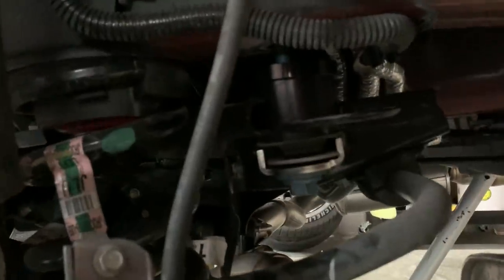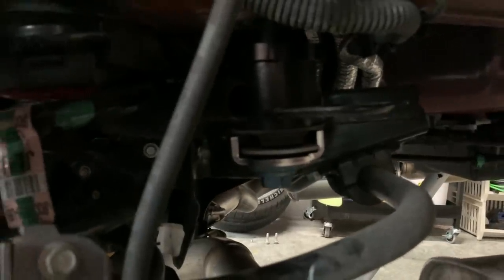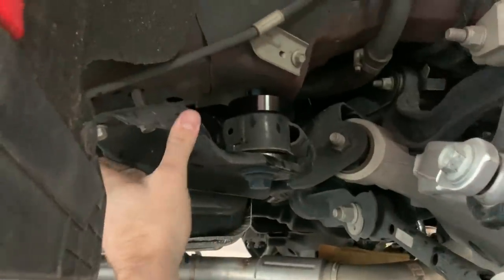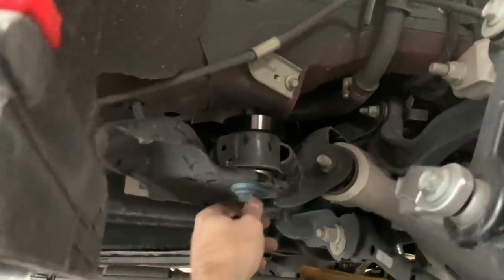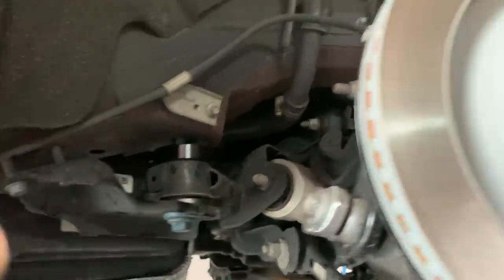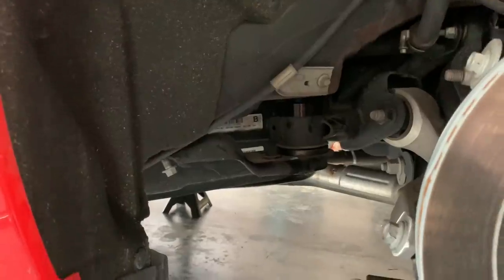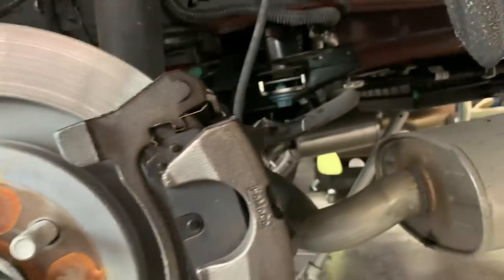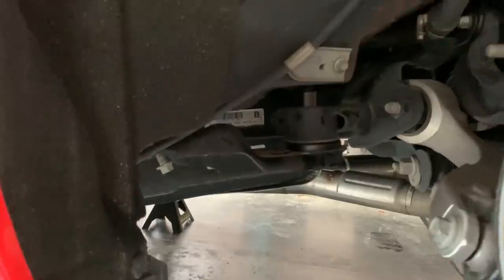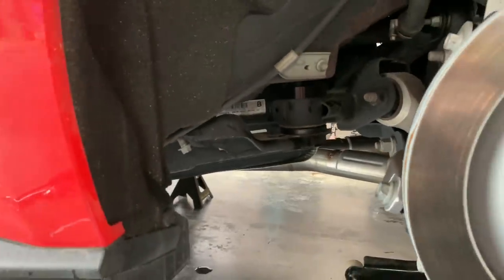For the rear, this is how this looks — you've got the top piece there and that silver piece is in a cradle just like that so it doesn't move. The bolt doesn't move inside of that and it locks it down perfectly. Now I've got everything going back together — I'm going to leave most of this pretty much loose, tighten it down just enough but leave room for the other side. Get all your bolts started and get them about halfway up on the back side as well, then jump to the other side and repeat the process — that wraps it up pretty much. Once you have everything going back together and the other side is complete, you're going to torque these subframe bolts to 129 pound-feet. Don't skip that step. If you have any popping when you're driving, make sure everything is re-torqued to spec and you should be good to go.